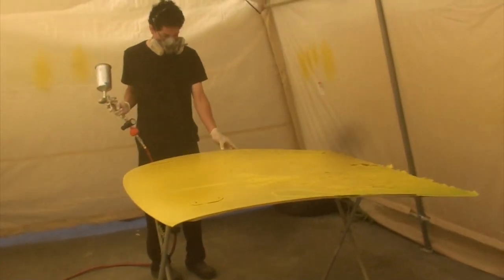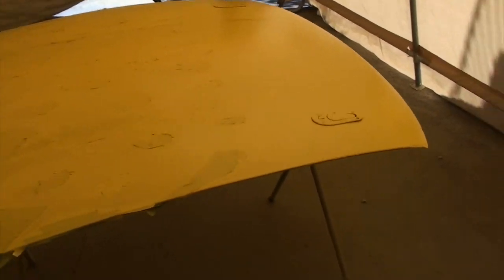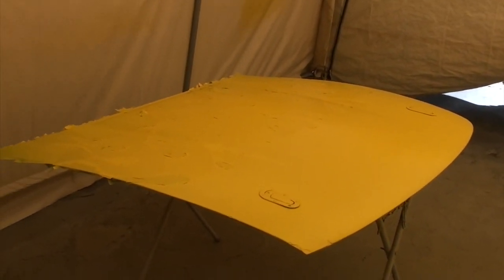Let's see where Julio's at. So kind of hard to tell how it's going because I was experimenting with laying it down super thin so I could figure out how I'm gonna do the top half of the Kevlar, but it's not going well. I feel like I might be doing too many coats, and I'm gonna have a really tough time getting rid of this hard edge. Also, some of the tape's been peeling up, so hopefully nothing got past it. The spots that were getting really bad, I went back and retaped. I think I got one. I'm probably gonna do one more coat. And then, I don't even know, man. I really don't even know. I just hope the hood at least matches the fenders. It's hard to tell with this camera, like the whole hood looks yellow.